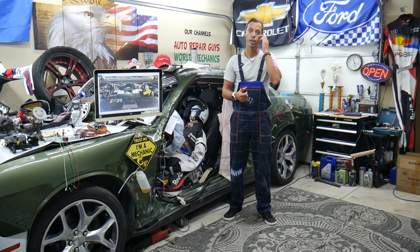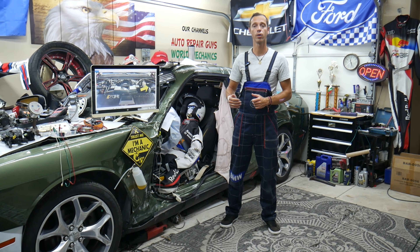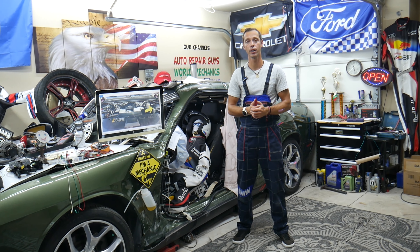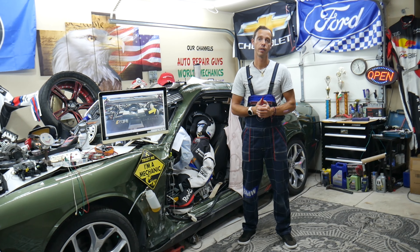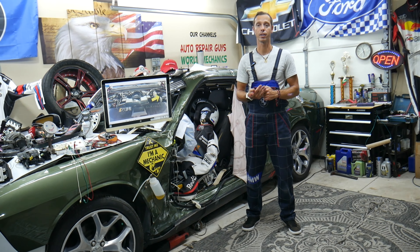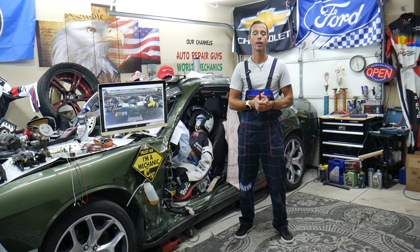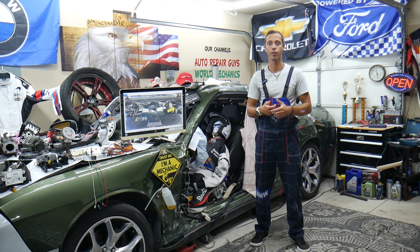Another thing — check that you're not low on coolant. Don't open the coolant reservoir when the engine is hot; it can spray you and burn you severely. Let the car sit overnight and check it the next morning. If the coolant level is low, that can cause it to overheat. Multiple things can cause low coolant level — it could be an external leak coming out of the engine, or internal burning through the cylinder head, going through the exhaust. That means you have something bad: head gaskets, cylinder head, or engine block.